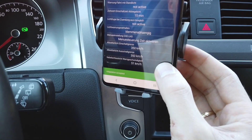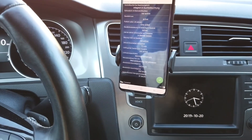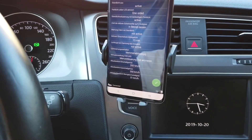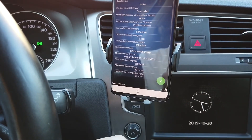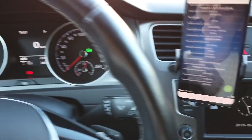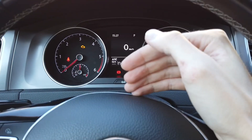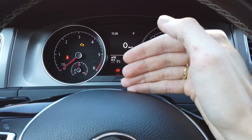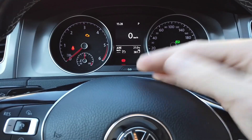This setting is responsible for warning you if you have your fog lights on and your speed is higher than the speed set here. So if I'm driving at 51 kilometers an hour or faster with my rear fog lights on, I should see a warning on the instrument cluster reminding me of the fog lights. Basically, if conditions are good enough to be going this fast, I shouldn't be using fog lights — I should turn them off.